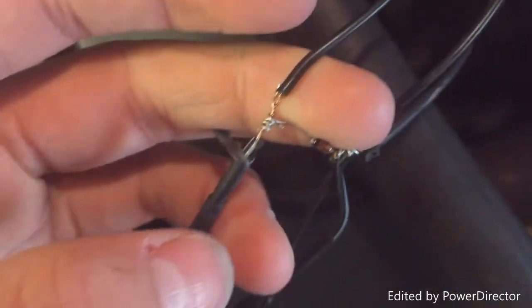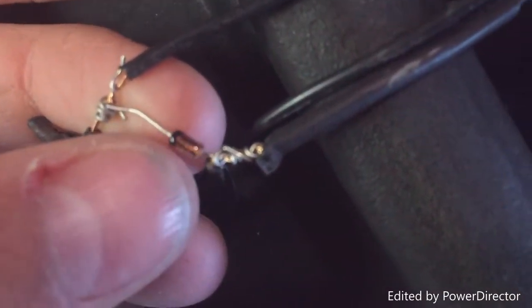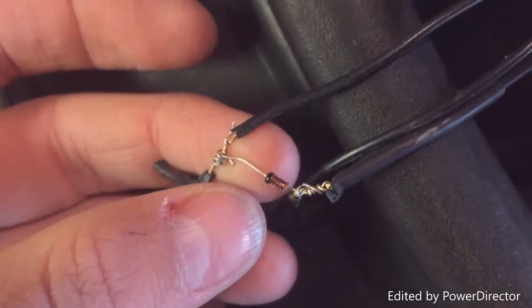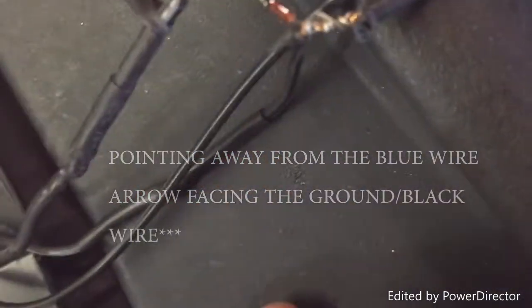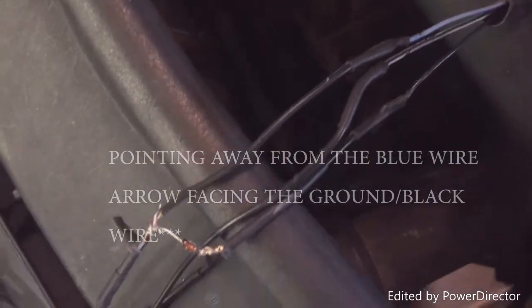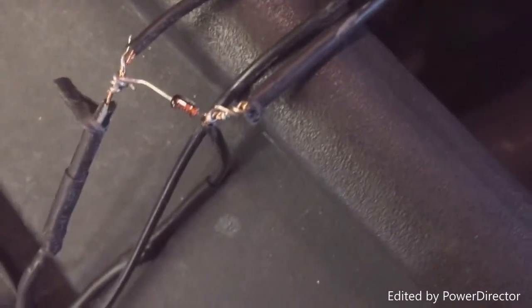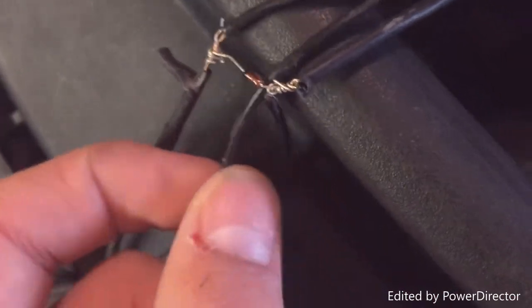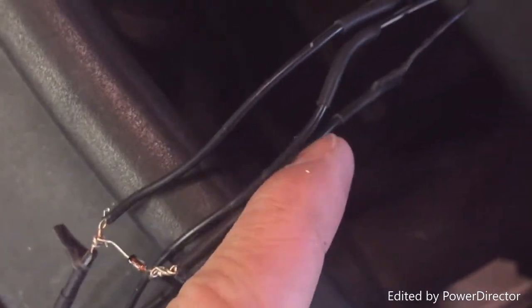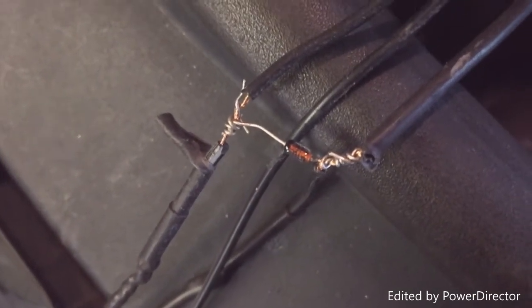So here's the blue wire right here. The blue wire comes down and right there you have to twist it onto the blue wire. The little black line on the diode faces the blue wire. Sometimes there will be an arrow — the arrow has to point away from the black wire going to the ground. So you basically splice into the blue wire there, and then going from that, you splice into the black or ground wire right here. Basically you just have to twist it in between those two.